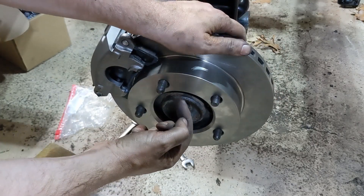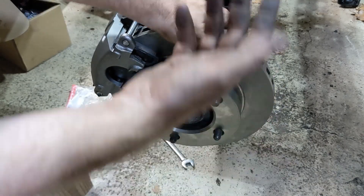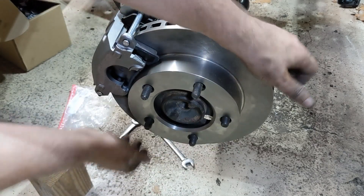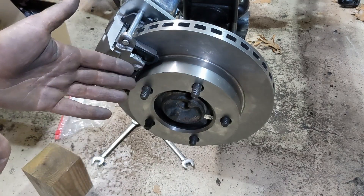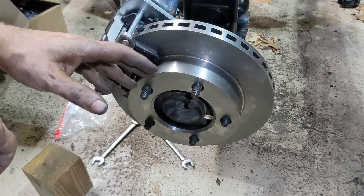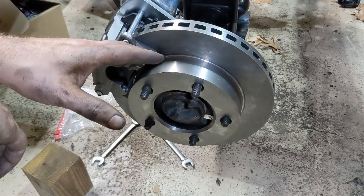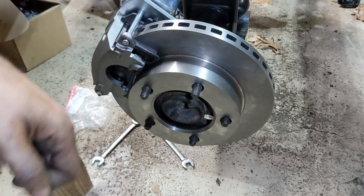This one's a little hard to turn — it's got a brand new SureGrip center section and I haven't even put lube in it yet. But I know it's turning, so I'm not too concerned. There you go — we've got an 8¾ converted from drum to disc brake. It was a bit more work than I was expecting because I had to machine these flanges, and the instructions weren't 100% clear on what came with the kit. Hopefully this is helpful. Thanks for watching.